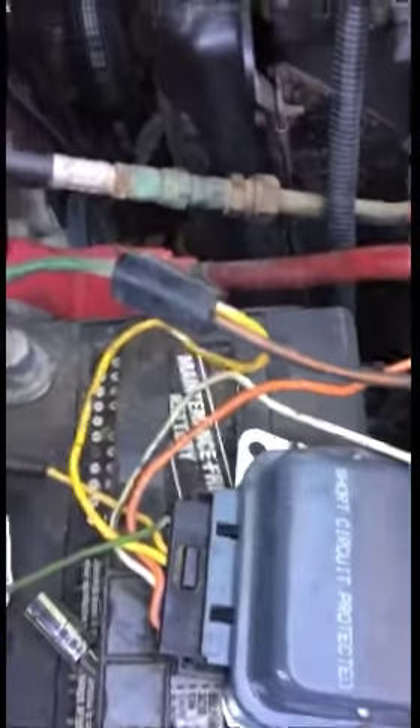Here you go - here's your tach with your ignition wire, the green and red, connected to that little splice that's connected to your pigtail. All your old wiring is out. Throw it back in the conduit and plug your tach connector back in - you should be ready to rock and roll. Tuck the red wire back into the conduit and back into the connector. Super simple - place it back in there, it's like nothing ever happened.